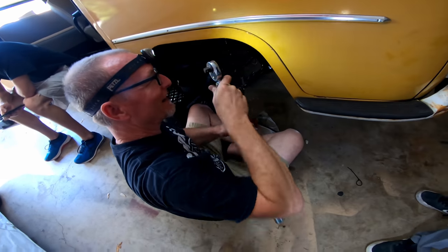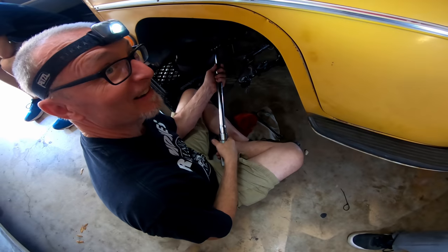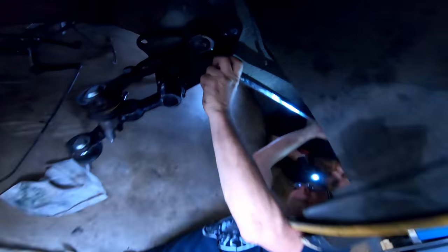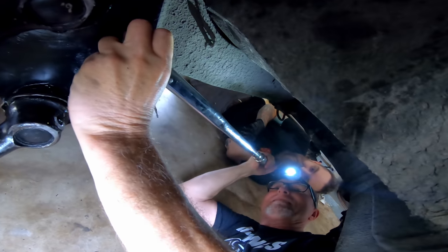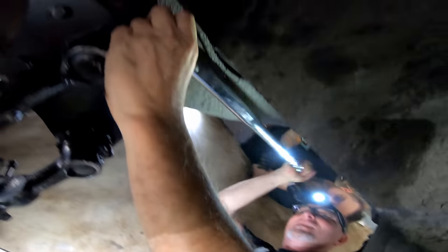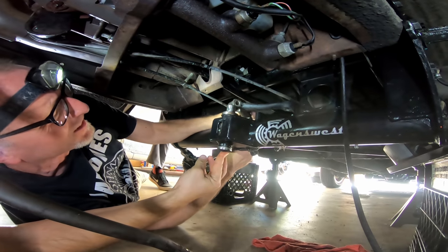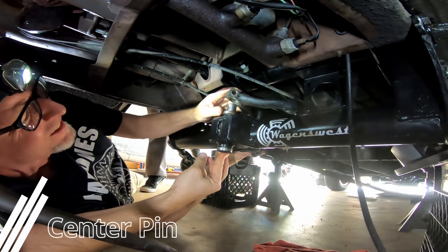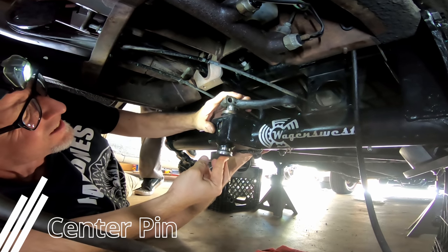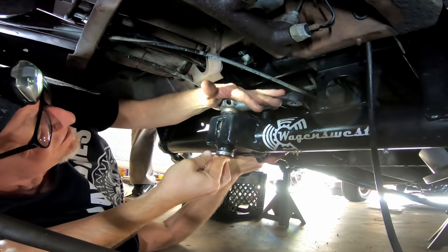With this wrench when you do back axles, you get into it - click, click, and done. We're going to torque this to 80 with Martin's giant wrench. It just does not seem like - even when we tightened them down before they were like... That's it.